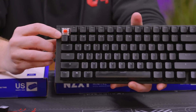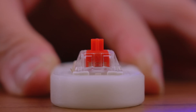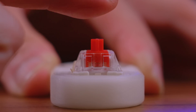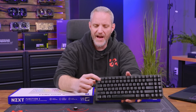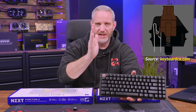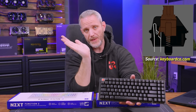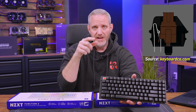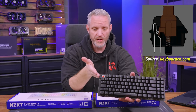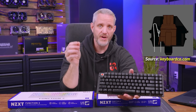When it comes to key switch types, what they're referring to is the actual button that you're pushing down to activate the key — whether that be the escape key, the A key, the space bar, shift. A mechanical switch means there's actually a little spring in there that when depressed, the spring trips and activates a circuit, a functional mechanical circuit, to tell the keyboard's PCB inside to send the signal to the computer saying this key was pressed.